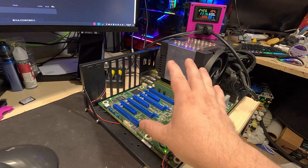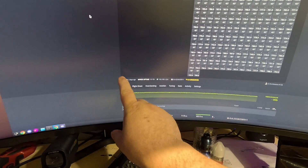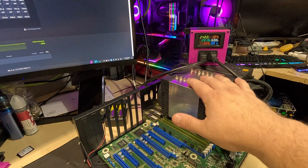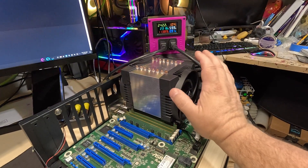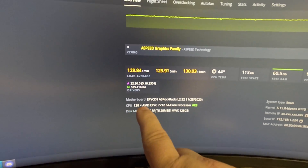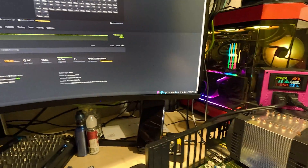Now I finally have the 7V12 installed. This has been running for basically two days with zero issues — mining Veruscoin on HiveOS running Hellminer. Miner uptime is one day, 15 hours. All 128 threads are running and they're only 45 degrees C. I love this heatsink — it's quiet, it's on 100%, and it's not even loud. Scrolling down for verification, this is the EPYC D8 ASRock Rack motherboard with 128 threads on the AMD EPYC 7V12 64-core processor with AES instructions. 44°C now — even better.